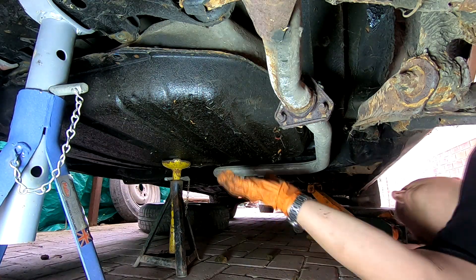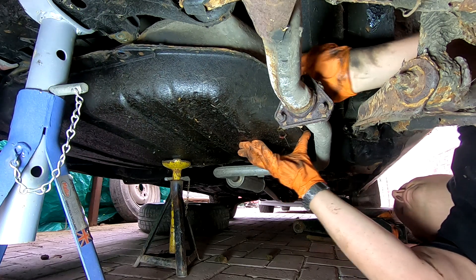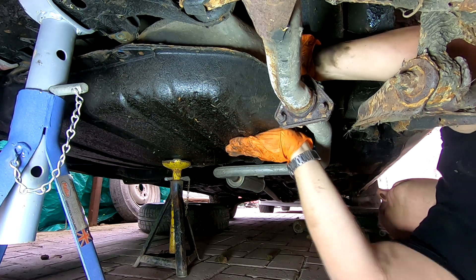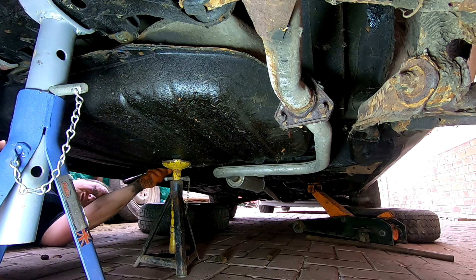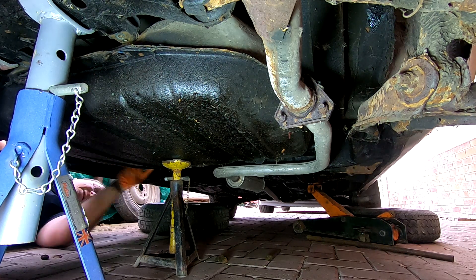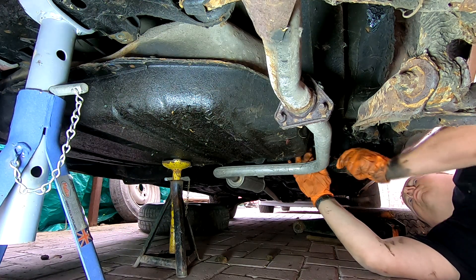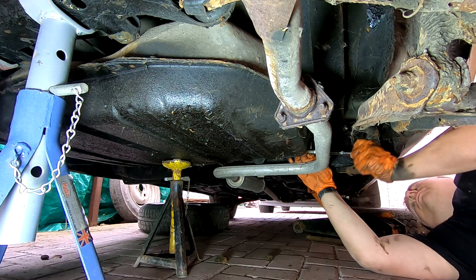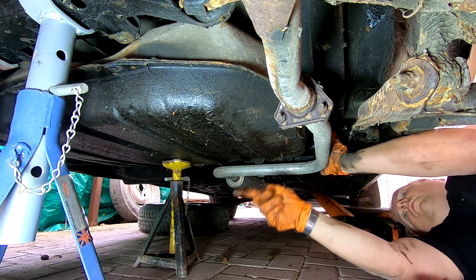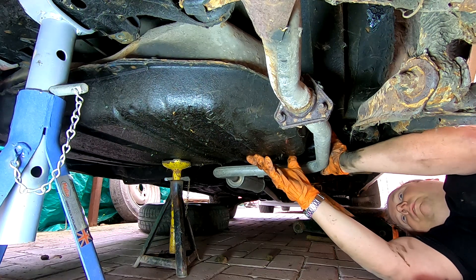Don't forget I'm on my own doing this. The tank should come towards me and then backwards. These front bolts have got to be undone a bit more — you've got to undo them so that the flange is clear of the lip on the tags. You haven't got to take them right out, but you do have to undo them enough so the flange is clear. What I could have done really was put the trolley jack under the middle there — I've made it a bit difficult for myself. But it's now ready to lower down.